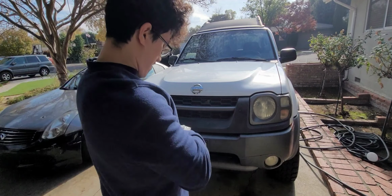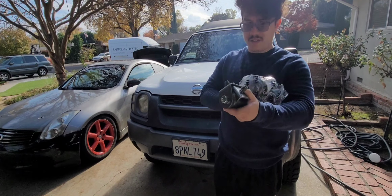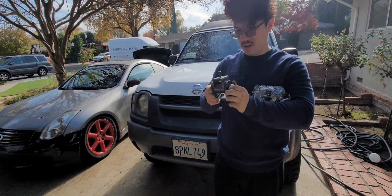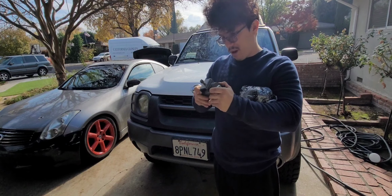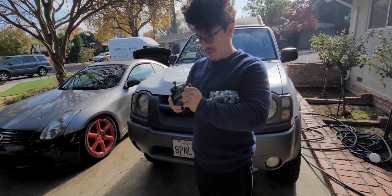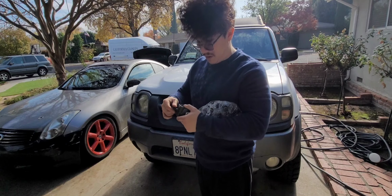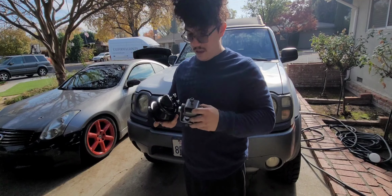Alright. Okay, this must have been eBay because it's a TRQ part. This is the Rugged Rocks solid mount. It has no washers in it, which is not great. I'm not super happy about that. And this is also not bolted down, even though it's a lock washer. So I guess this guy gets somehow torqued when you're in the car. I think it's poly. Yeah, it's poly. Not Poly D from Jersey Shore, but it's a poly mount. Probably gonna tighten this guy before I put it in the actual truck. But it's just straight up bolts. It's weird. I'm gonna have to find washers to put in this guy, but in the comparison of size to the factory part, huge difference.